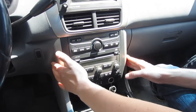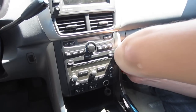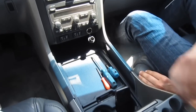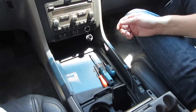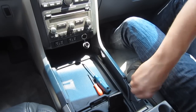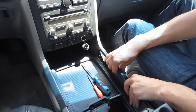The first step is to remove these two side panels, and they come off pretty hard. You've got to use your fingers to kind of yank them out. Sometimes it doesn't work, so what we suggest you do is open the armrest up and remove this piece — it just comes off. Then you have this screw here, so we're going to remove this screw, and it's going to give us some room to play with. Once you remove the screw, you can just lift this panel up.